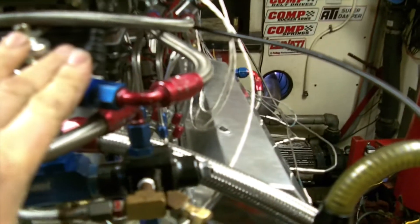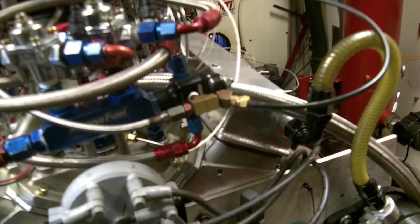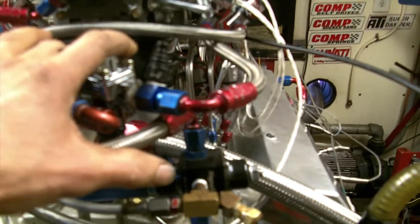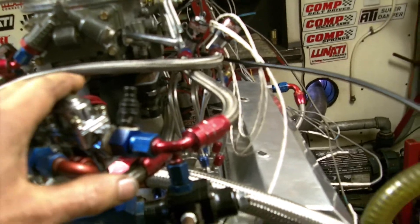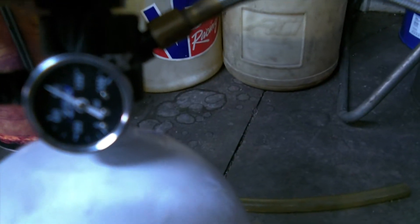The first stage is here, second stage is here. The third stage, which we don't have, he's got to put that in his car — but this is on his carburetor. He's got a separate system for his carburetor by itself, so it just runs at 8 pounds. And these three are going to be the nitrous — the Magnafuel two Holleys is all we need. This one is a 6.5, this one's a 6.5, but that's only on a 225-250 shot. The fogger's all done. The plate system, as you can see, is all sixes — this should be a number 8 right here, but we only have a number 6. We had the bottle right at 925 pounds, and it's sitting here right now at about 900 pounds.